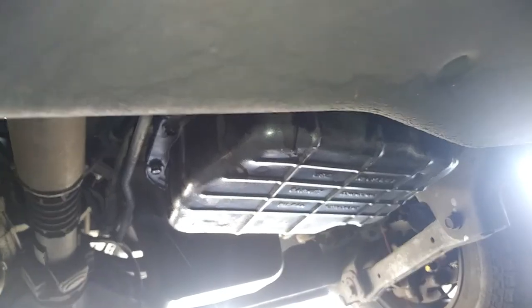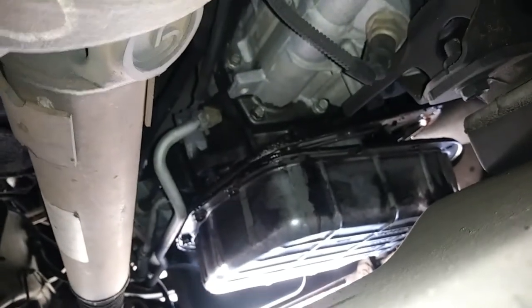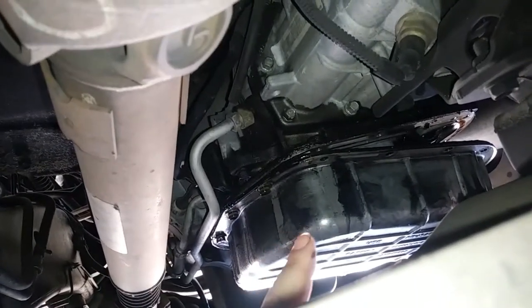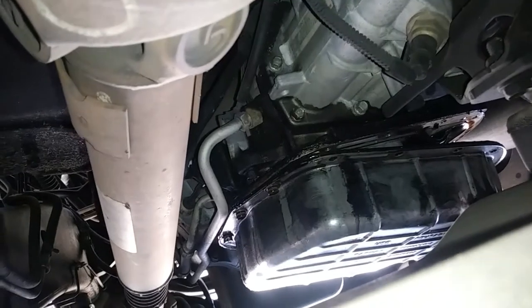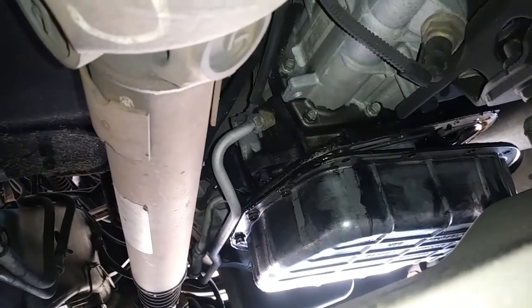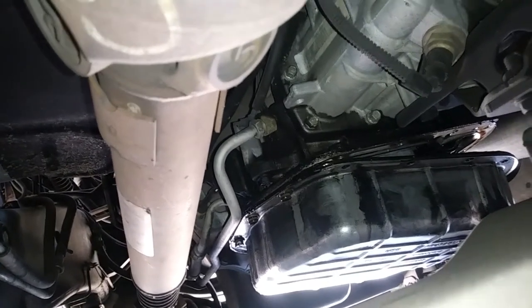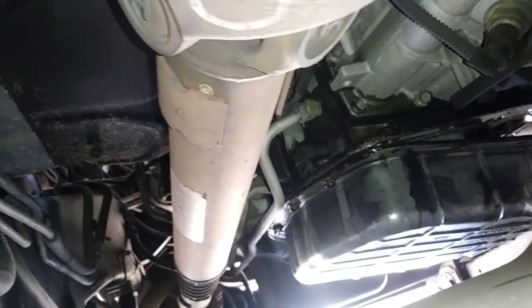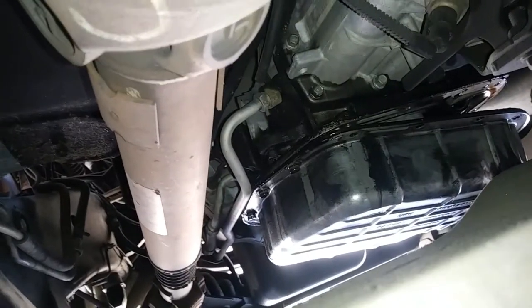I did order a drain plug kit, but I'm not sure if it's going to be here in time, so we'll see. I may just be putting it back together like this. Yeah, took all the bolts out, except for the U shape around the back here. Left one bolt on either end, and then all the ones on the back. Eventually, just the weight of the oil broke the gasket by itself, but you could have cracked it with a screwdriver, too. And then I've just been slowly working these bolts here to tilt out of that corner and drain as much as possible.